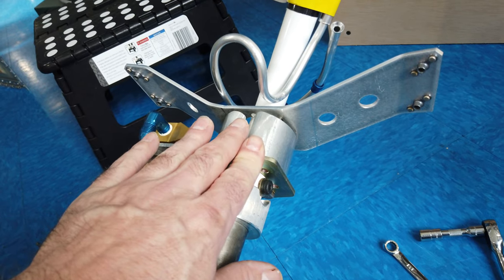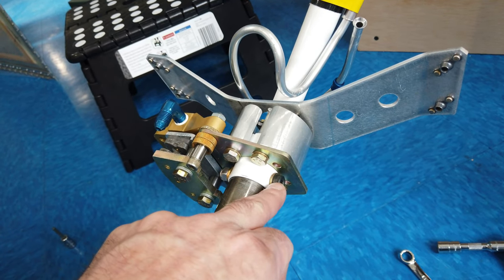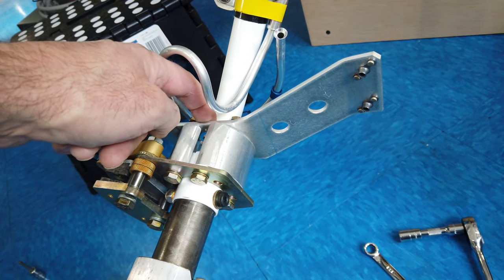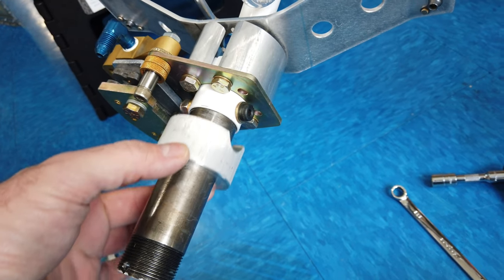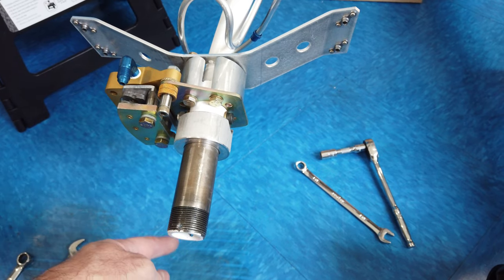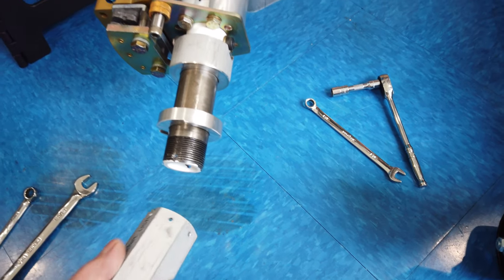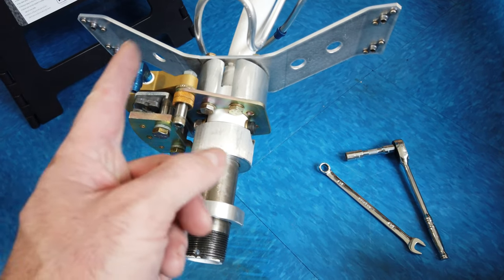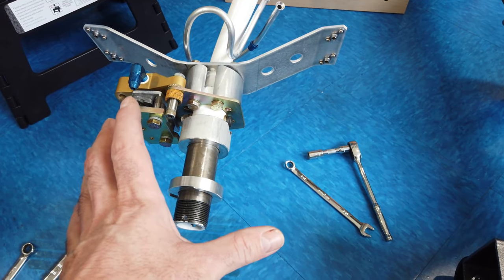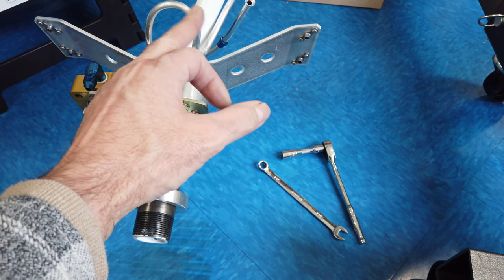My sub-assembly is on. I've got my through-bolt axle attachment bolt in place with the appropriate washers. I will bring this back plate up and run these four bolts in to secure that, then run this spacer and seat it all the way. Then I can bring my wheel assembly over with the brake disc, put those together, put on the outside spacer, and run this nut in nice and tight. Just make sure the brake disc aligns nicely with the caliper with no binding. Then I'll go ahead and run this fitting in all the way and re-bend this brake line.